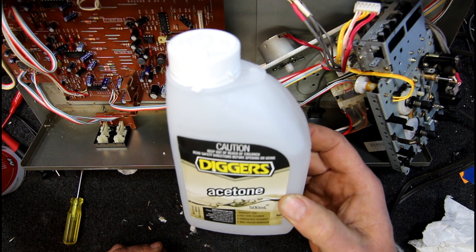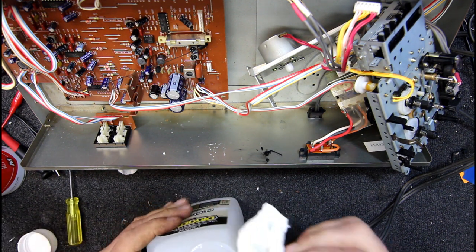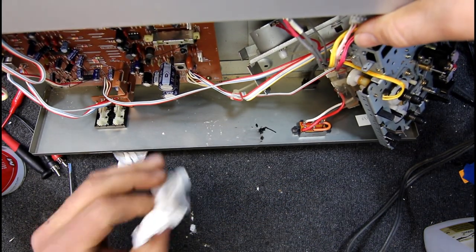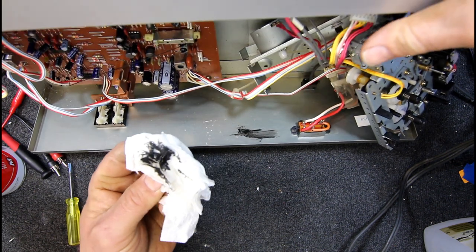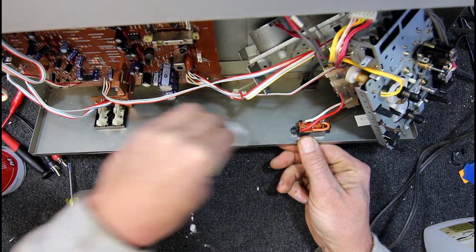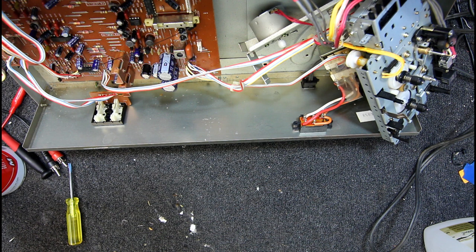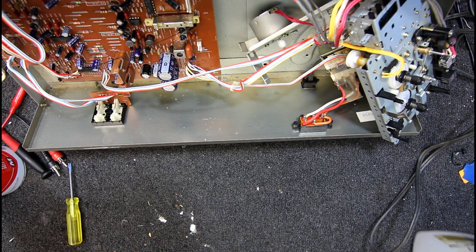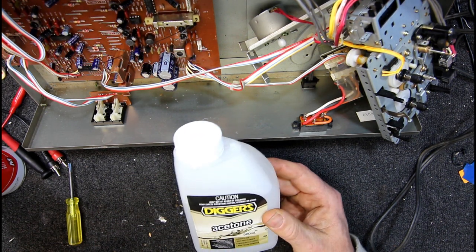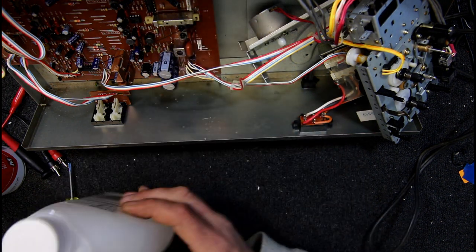One of the beauties about this is that if you do get it on yourself, you can actually wipe that belt stuff off your skin better than anything I've tried before — normally it's on there for two or three days. Of course, quickly wash it off again just to be safe. Here's a demo straight out of the bottle on the back panel of this old Sony tape deck, which still had some residue on it. Look at that — it just smears it, and this stuff is real super sticky and horrible, but acetone just takes it right off, dissolves it.